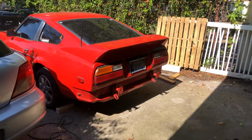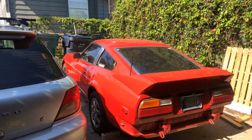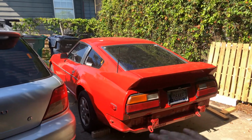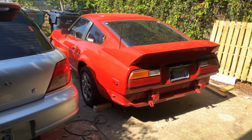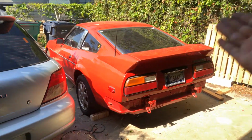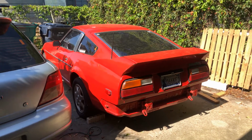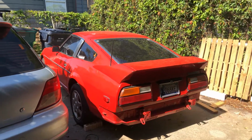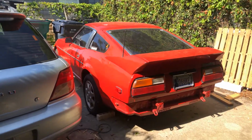The first thing we're probably going to do is I got to get some different front wheels on it and get the front suspension in, and then put all the adjustable arms in the back. And we'll kind of see how it sits, what coilover length we need, that kind of thing. I need to touch up some of the welds on that cross member like I showed. I may gusset it a little bit, tie from frame rail to the member, just really beef it up in there, tie from the shock towers to the frame rail, that kind of thing.